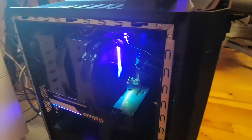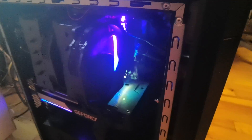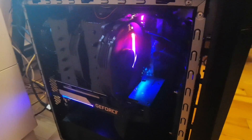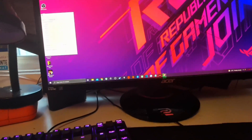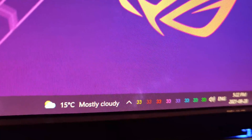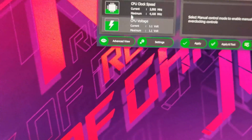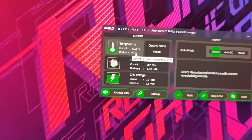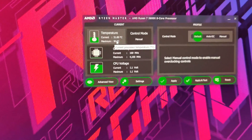Okay guys, I'm back. It's all assembled. Had some issue with my RAM - for some reason it didn't want to start at 3200 MHz, so I had to move some of the sticks so that the motherboard would accept it and start. Right now I'm idling at 33 Celsius on Core Temp. This other software shows higher readings because it shows the hottest core, so I'm at 32-33 right now. My room is about 20-22 degrees, so that's really good.